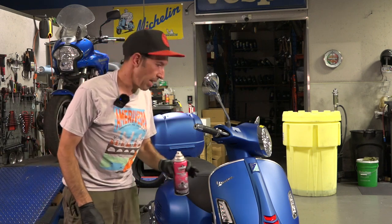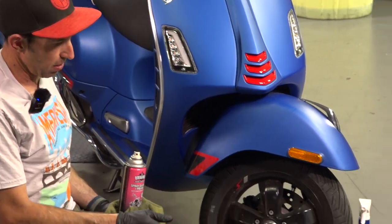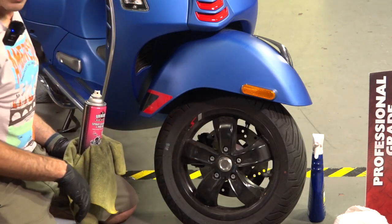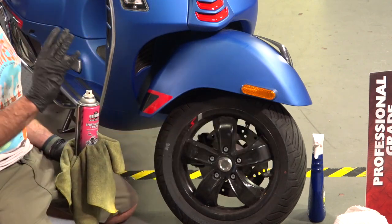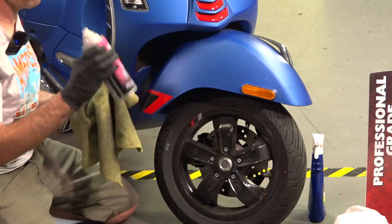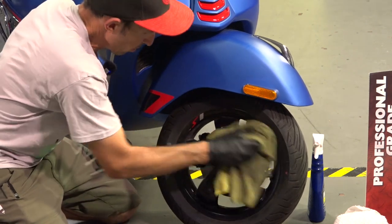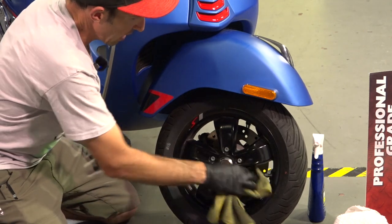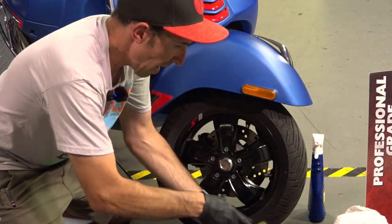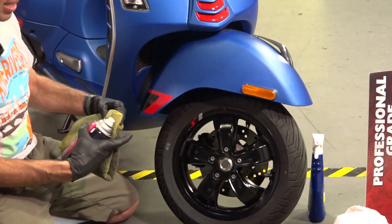One more thing: the wheels. Do not use Armor All or any automotive tire protectant that glosses up the sidewall — it's just a bad idea. It will creep with centrifugal force and go right onto the tread, and then if you make an emergency swerve, you've got a nice greased-up tire. Just not worth it. You can certainly clean wheels with a little soap, but I wouldn't even allow a wax-type spray cleaner on the wheel. Also, spray the product onto the rag, not onto the wheel directly, so you don't get it on the tire or brakes — it's hard to burn this product off the brakes.